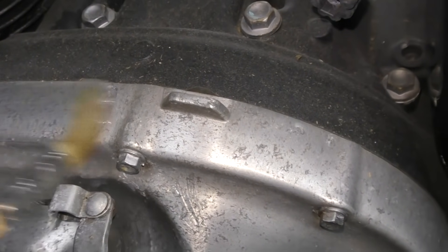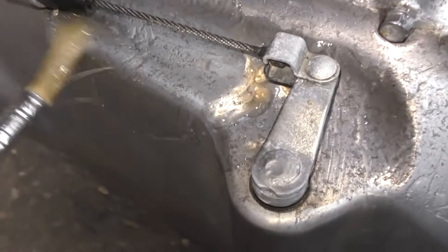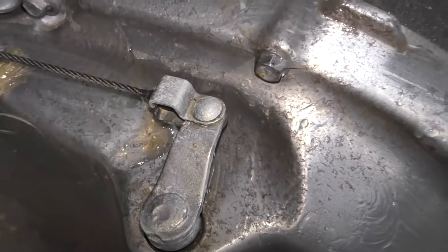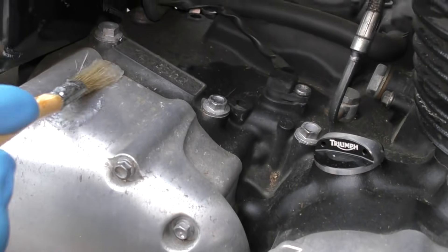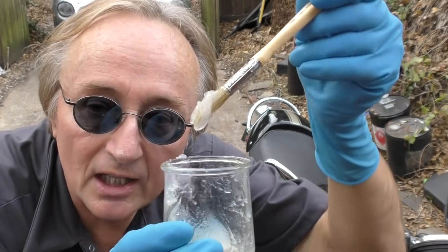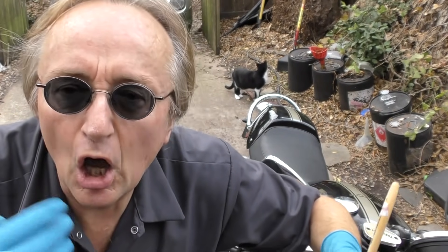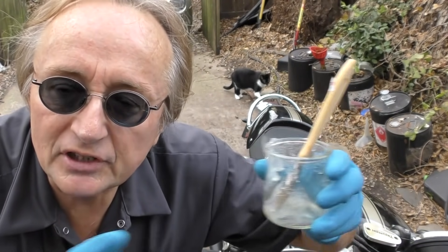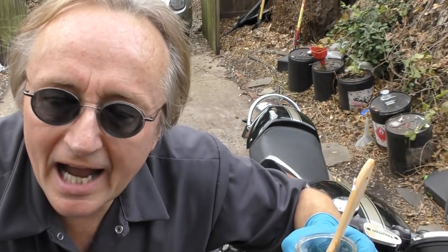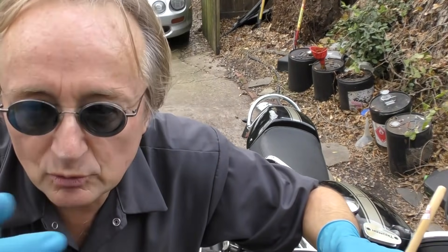As you're going to see here, it also works great at taking corrosion off of aluminum. I just put this stuff on and you can see it's already starting to lift off a bunch of the corrosion — I'm going to do some of this transmission case too. The big advantage of a gel is that it's gooey and it sticks; if you use a liquid it's going to drip all over the place. The stuff stays in place and does its job — you just need to have the patience to wait up to a whole hour.